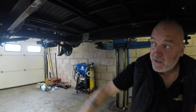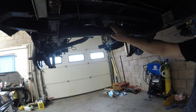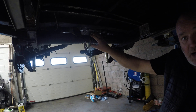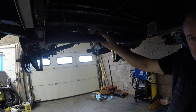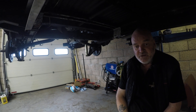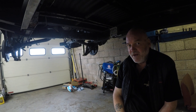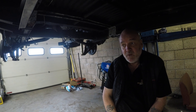Then from the back of there, we're going to go up into where the engine bay was, and there's going to be another six Tesla battery modules in the rear box. These will be connected in series, which will give us the 350 to 400 volts we need to run the Tesla small drive rear unit. Yes, we're putting a Tesla motor in here, with a new subframe — so it's going to be quite the machine.